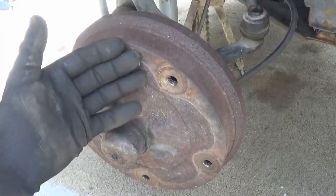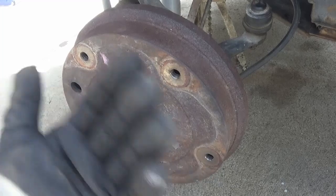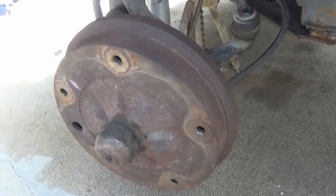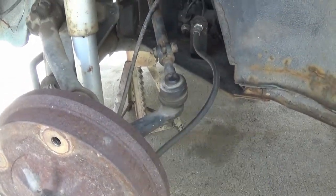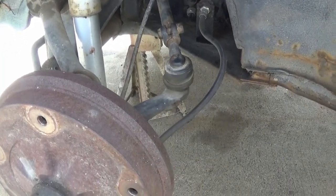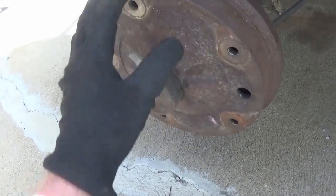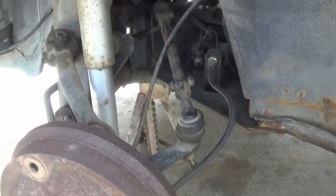We put new wheel cylinders in there, brake adjusters, pads. We did the whole nine yards to it, and that never solved the problem. It was so annoying. But check your brake lines. If your brake lines are old and cracked, or if they're just old, I'm not kidding you, it reduces the pedal pressure, and the springs will squeeze the brakes back away from the drums quick, and everything works the way it was meant to work, and it works so good.